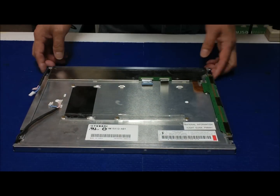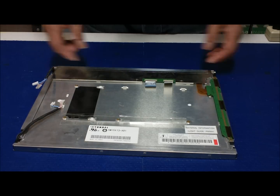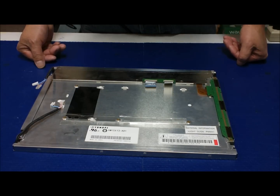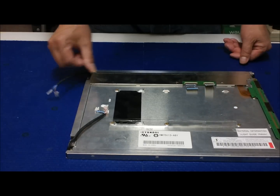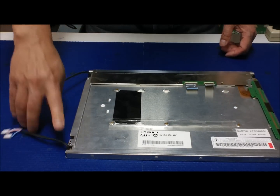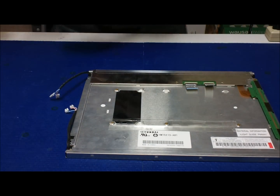This is a 15-inch screen with a full backlight lamp. Basically, without disassembling the whole LCD screen, you can just pull this reflector out. It's quite easy. This reflector is held by two small screws. You just unscrew and pull it out. Let me show you.